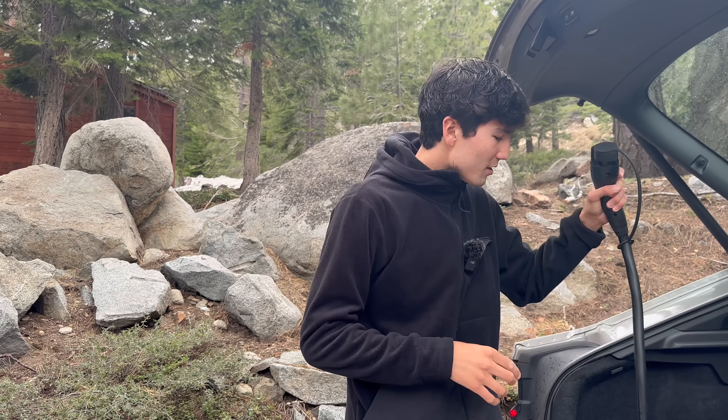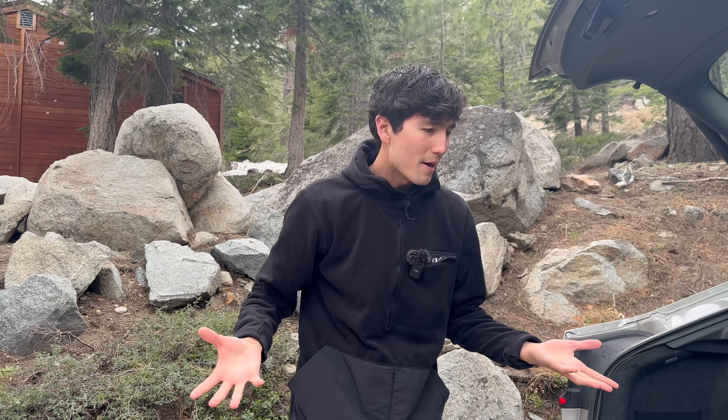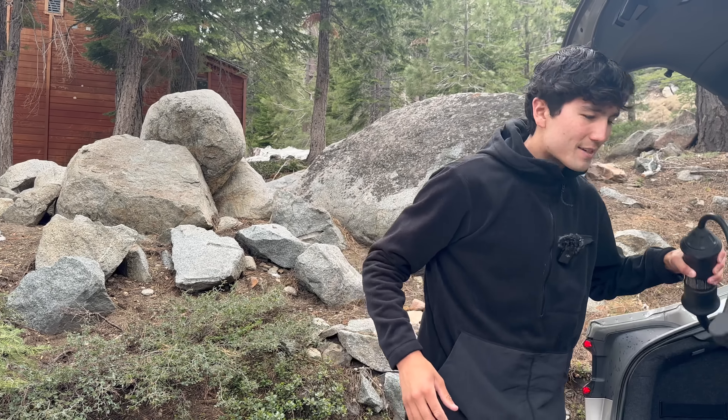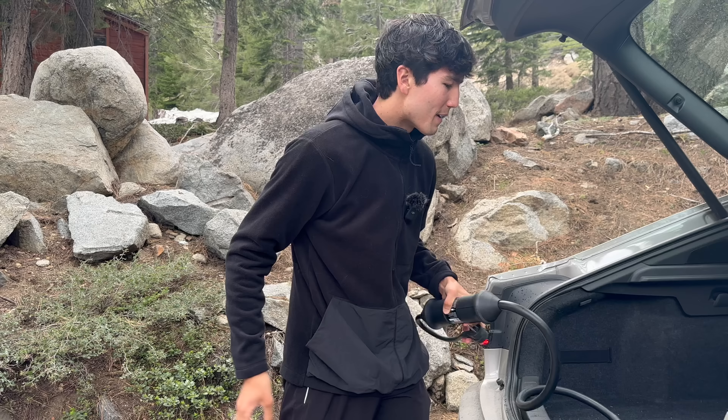One more nerdy note: these are not chargers, technically. These are what are called electric vehicle supply equipment, or EVSE. The charger is actually built into your car. So if your car is like a base Tesla Model 3, it actually doesn't have a 48-amp charger — I think it's 40 amps or even 32 amps — meaning you don't need an over-specced wall connector or mobile connector if your car has a lower-level built-in charger. In every modern electric car, the actual charging component that converts AC power from the wall to DC is in the car. That's why these units are so cheap and compact — all they really have to do is deliver power to the car, and the onboard charger does the translation to put direct current into the battery.